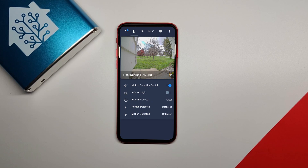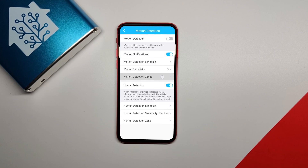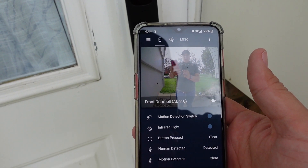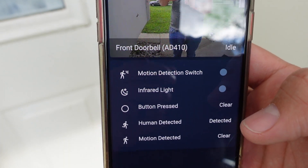The doorbell motion alarm sensor activates when the doorbell sees motion. The zones and sensitivity for this sensor are set up in the Amcrest app and cannot be changed in Home Assistant. This sensor can be useful for things like turning on lights, playing sounds, or triggering notifications when motion is detected. The smart motion human sensor is activated when it detects a human rather than just motion in front of the doorbell. I thought this would be nice because I wouldn't be getting notified every time the 5,000 cats in our neighborhood walk by, but it actually did pick up a few cats. The other binary sensors I tried, even with all events enabled, did not seem to work and don't apply to this camera. They serve no function and I don't even see any corresponding options in the Amcrest app, so I'm just using these three sensors and ignoring the rest.